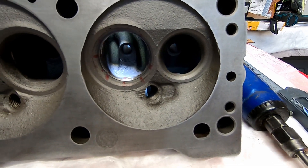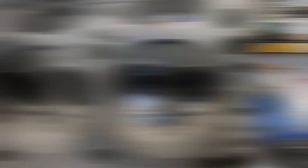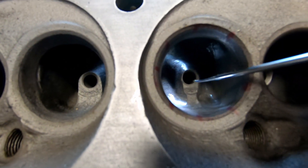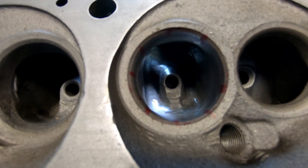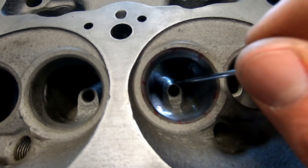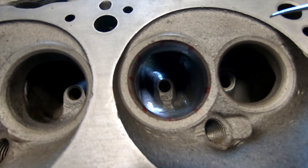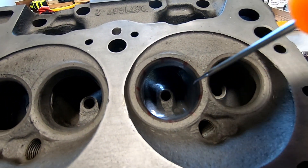I'm doing them all at that. It'll be 89% now, and when he does the larger valve it will decrease that zone. So here is intake number one. And if you compare to that, I think it's a lot better. I'm getting confirmation on whether or not I should go ahead and shave that all the way down. I found the Dulcich videos online and his picture did look like that's gone, but maybe he had taken a lot of the guide out. I don't typically like to do that because I'd rather the valve have a lot of strength when it's coming in and out.